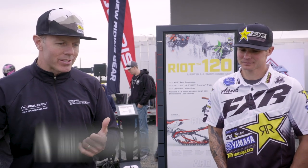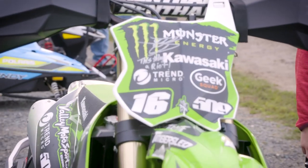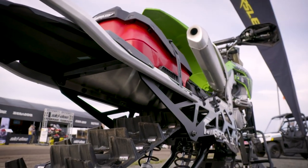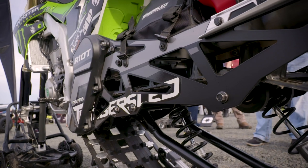One of the riders in the video said it's just like my dirt bike. When you ride it, you're active on the bike — your body movements translate into traction and terrain changes. It's got all the drivetrain updates: the jackshaft is more compact with fewer moving parts. The Riot comes in two models — the base model with Timber Sled fully rebuildable aluminum body IFP shocks, and the LE model which comes in colors and features QS3 shocks that let you adjust the personality of the bike depending on terrain. You can set it up for hill climbing, wheelie mode with soft in the back and stiff in the front, or for bombing down the trail — giving you a lot of different options in just three clicks on each shock.